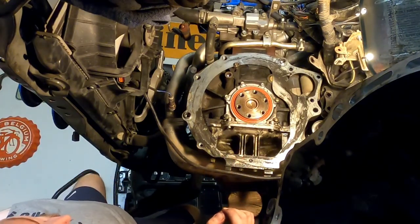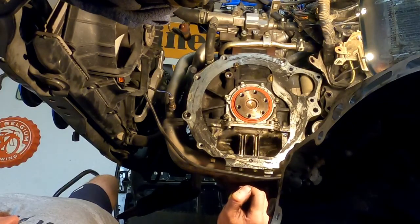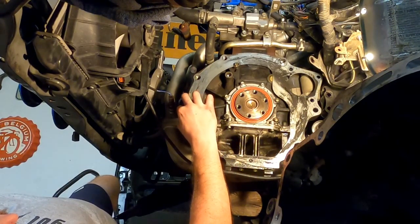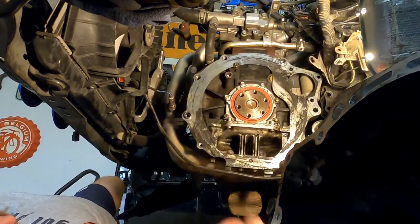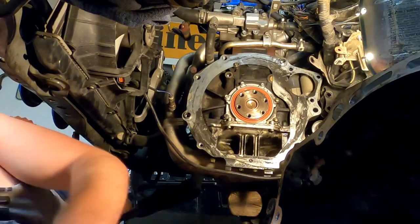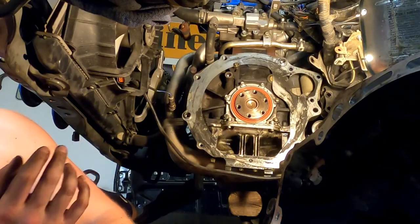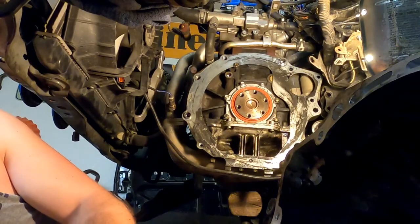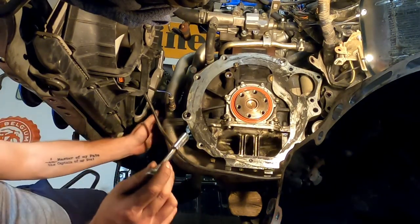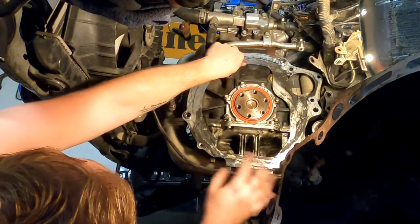There we go. Well, there's the rear main seal. Let's get the flywheel out and look at it. No, I want to clean this out. I don't want to leave this as dirty in here. I'm going to remove that 10 millimeter bolt and pull this little plate off here. I'm going to get some degreaser and spray this down. We'll probably call that quits for tonight, just because I've got a lot I've got to do, and we don't all need to be on here while I clean this up. So use your favorite degreaser. Get all this nasty cleaned up before you reinstall this.